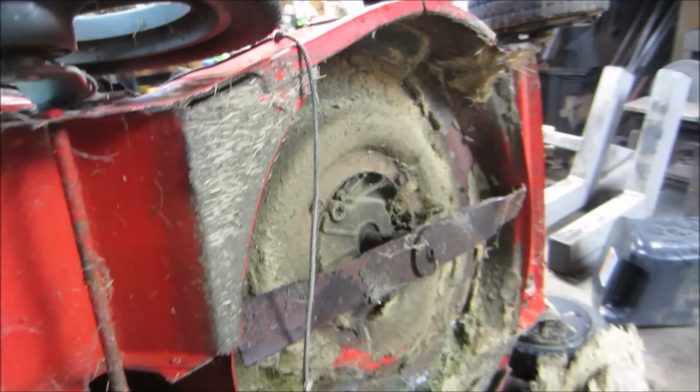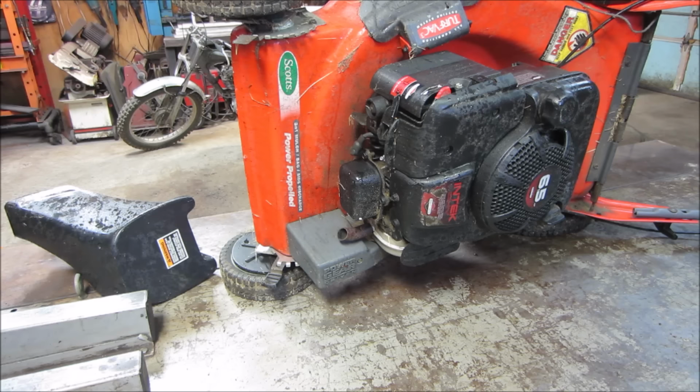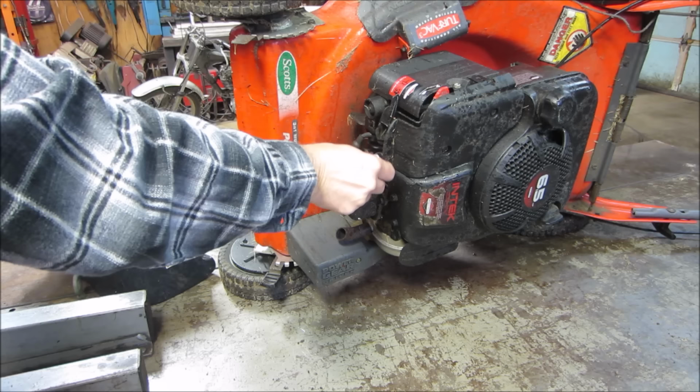So we'll do our little preliminary on it. We should probably pull the plug on it and see if the engine spins okay. Let me get you set up in the stand and we'll get into it. I got a clamp on the safety lockout up on the handles for the brake. Pop that plug out. I just want to spin the engine over,